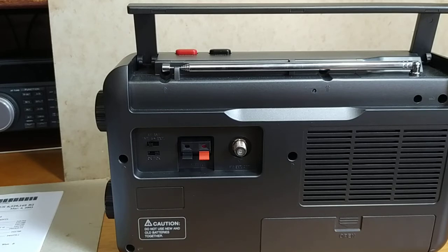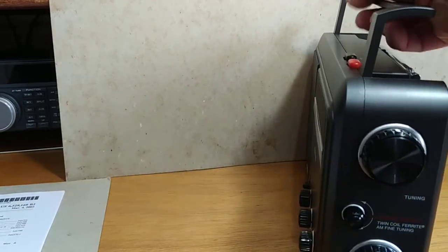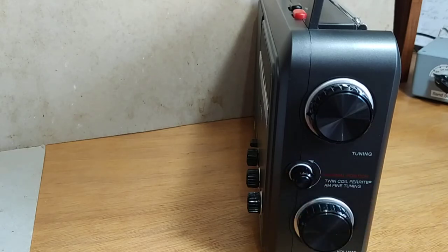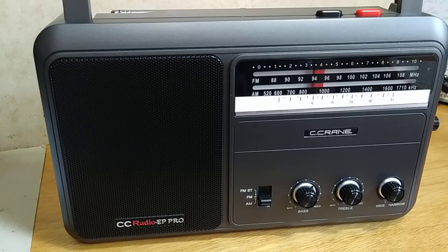Those are the main advantages of the EP Pro. The tuning knob on the side works extremely well — it has a normal centre position and you can tune it up or down to peak the signal. If there are two stations on one frequency, by turning it one way or the other you can bring one station into better tune and essentially eliminate the other, splitting the two stations so you can hear the one you want. This is a great medium wave DX radio, and I'm receiving stations over 8,000 miles away just on the ferrite rod antenna — which is quite amazing.